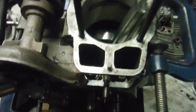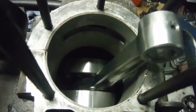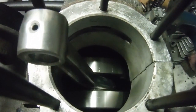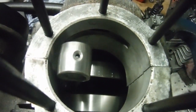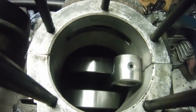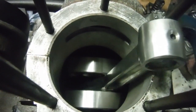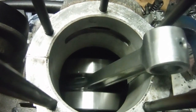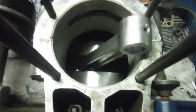If I rotate the crank between my finger and thumb down there on the timing side main shaft, you'll see that I can turn the crank to pull the conrod down, let go of it, and it comes back up. Rotate it the other way, pull the conrod down, let go — comes back up. It rotates nice and freely all the way round, even rolls back a little bit after stopping. So that's nice and free and all ready to go.